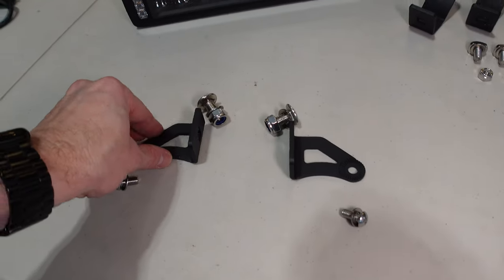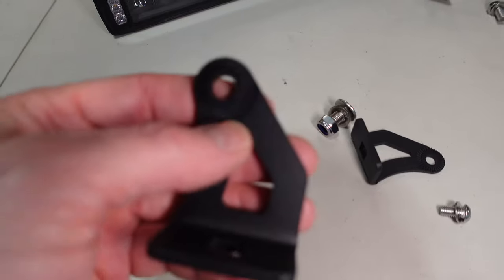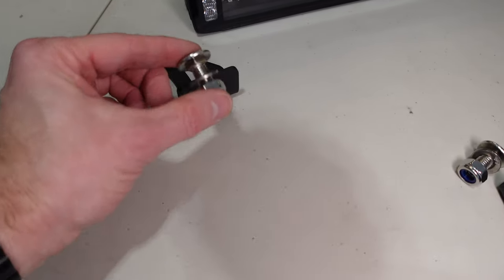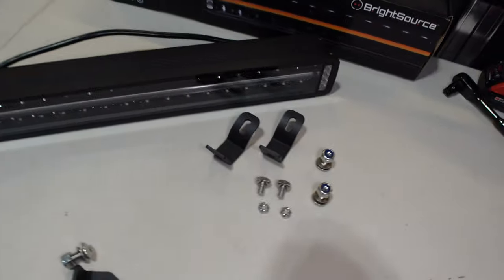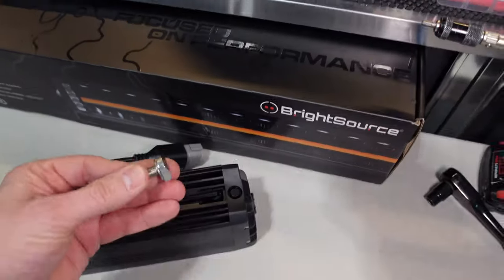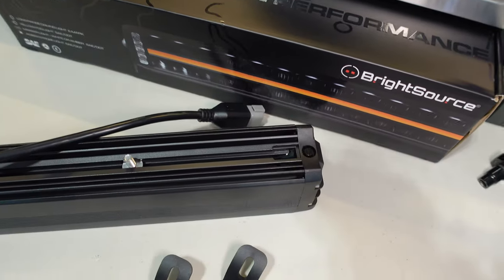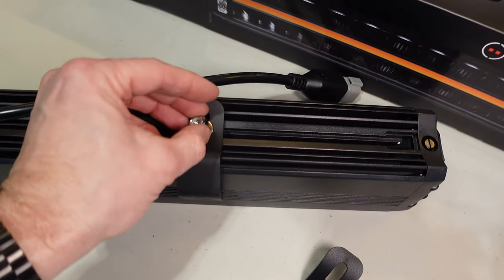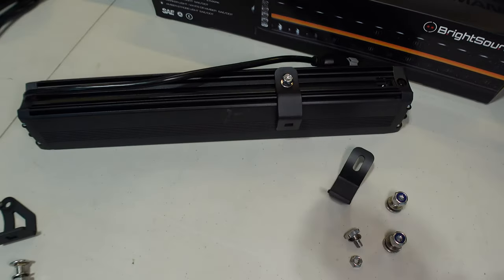I've got my F-150 pulled in here — it's a work truck I own, not the typical truck you see on my channel. We are going to do a very temporary install to show how simple it is to wire up to this vehicle. We have a few different mounting options for the light bar and it does come with all the necessary hardware. There are typical side mount brackets with little notches to help secure the light bar in different positions and angles. You have bolts to hook those up and a mounting bolt that goes into whatever mounting plate or bracket you're securing it to. For this temporary install, I'm using a special nut that fits in a recess on the back of the bar — it slides down the channel — then you add a bracket, a washer, and a nylon nut, and figure out where the bracket will be positioned.